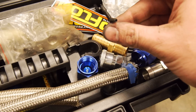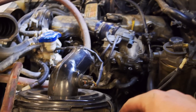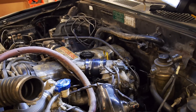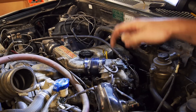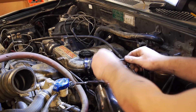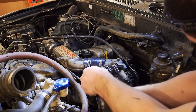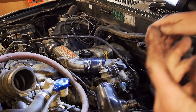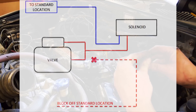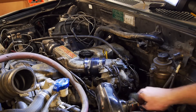I've got a T-fitting in my box of tricks — that will be perfect. There's also a good chance I've got some new silicone hose, so I'm going to replace all these rubber vacuum hoses with silicone. It's a big necessity for me — I can't stand rubber, it always gets frail and cracks. The T goes on there, knock those old hoses off — see how loose they were? Then it's just a matter of blocking this port off by screwing a little screw into the end and pushing it on, and we're good.